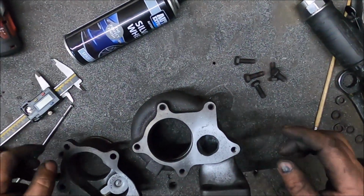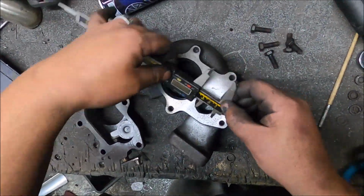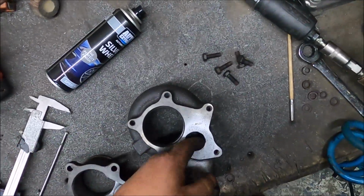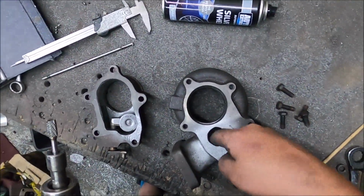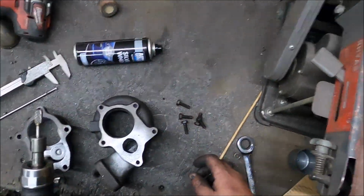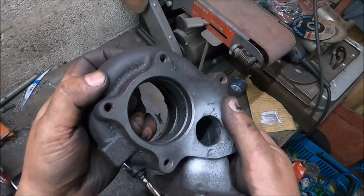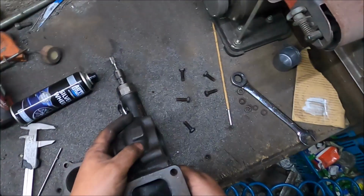That is near as damn it, not the most perfectly round, but 30 all round. This is 32 diameter, so I'd say this is a safe bet with no leaks. I'll just now make it as smooth as possible, because 30 is obviously at the edge. It does feel like it still goes in a little bit at points. Right, I think I better stop now. Any more is fucking ridiculous. There's no way that's going to creep. No way. I'll tidy it up after, but yeah.